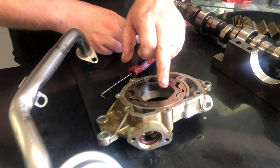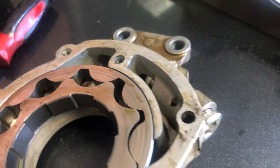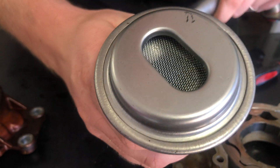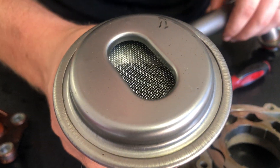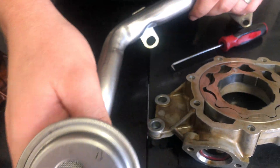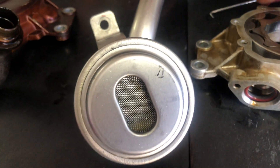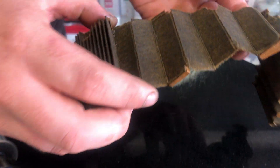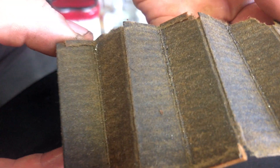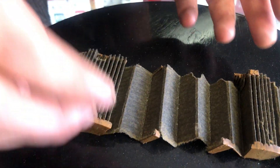As you can see, there are a lot of marks on that. What happens is debris can get stuck in there — if you look at the pickup, that's what it sucks your oil through. You've got a gauze there which catches some of the big bits, but a lot of the fine metal still gets through. This section here gets unfiltered oil; that gauze is its only defence to keep debris out. After it goes through here it normally goes to the oil filter, and if you look at this one, it's actually got quite a lot of metal which has gotten through the oil pump — and that's what can do the damage.